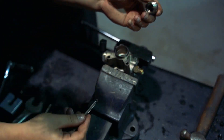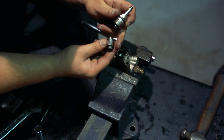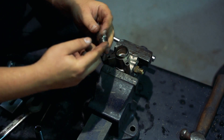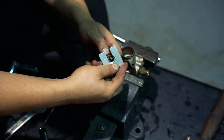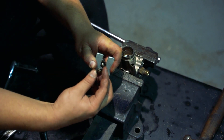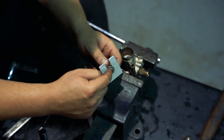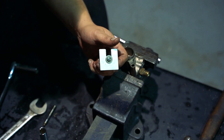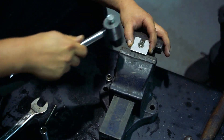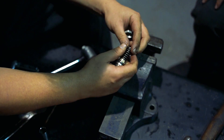Now you've got that cap off, you need to slide that through there to its maximum point. You've got the big end and the small end — the small end needs to go downwards, so the big end needs to go up inside. You put that on like that. You use the installation tool, slide that over, then get the follower end and put that in. Lift that up, then get a rubber mallet and tap that down to lock it in place. Once locked, you can remove the tool. Push that down, pull that out, put that on there, and that is done. It's that simple.